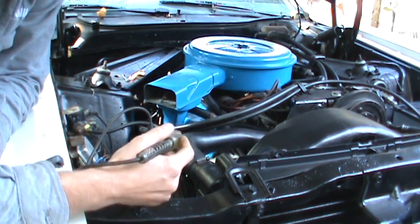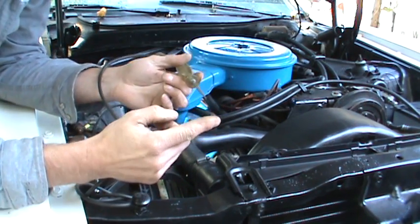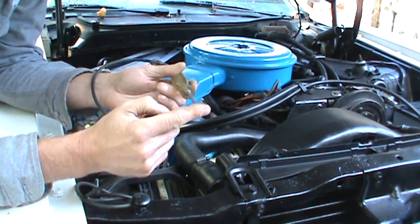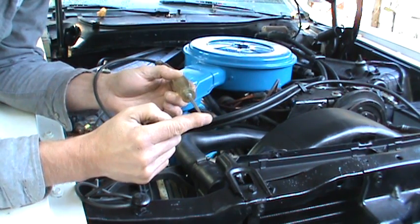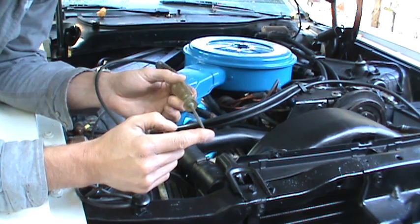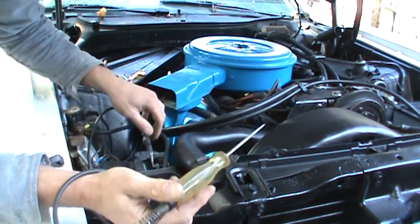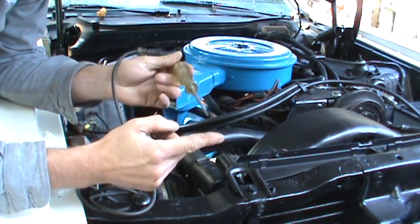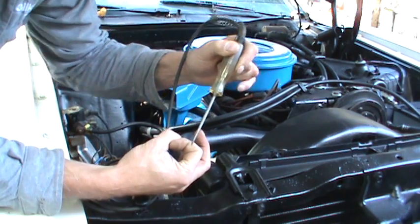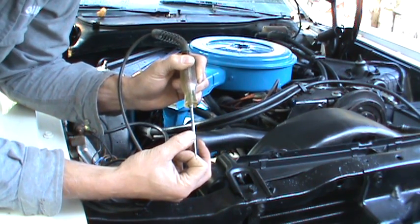With automotive bulbs, the two elements are not the same resistance — your brake lights are brighter than your tail lights. So what you can do is go right to the battery with your ground, go around to the back where the light is, and touch right on the two center posts of your brake and tail light socket. If you have power on both, you know power's good. Then switch around — go from negative onto positive and touch the body of the socket. If it doesn't light up, you have no ground going to that socket. Usually it's a ground strap to the bed that was lost.